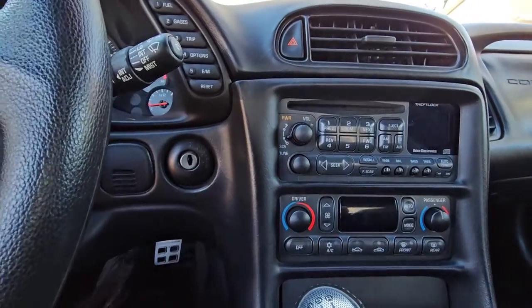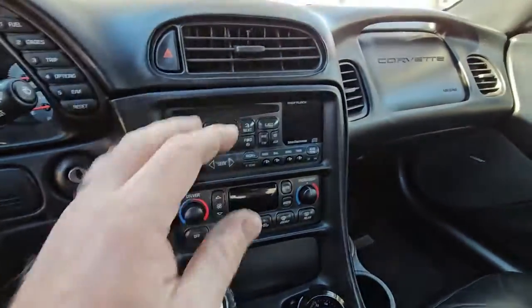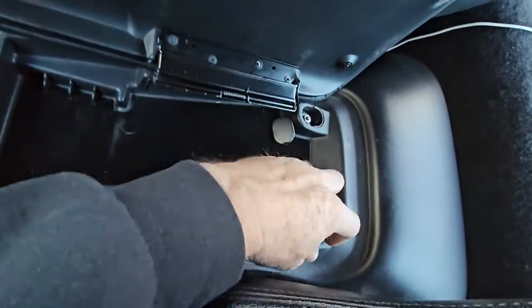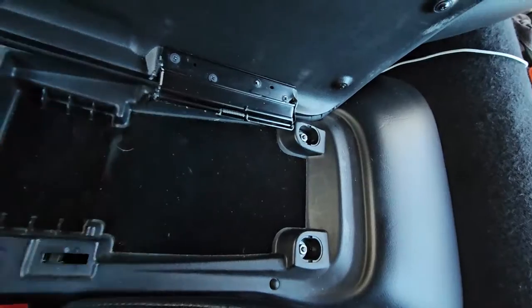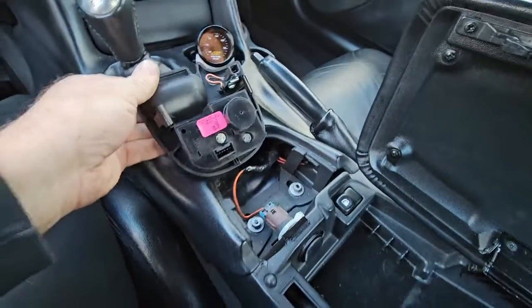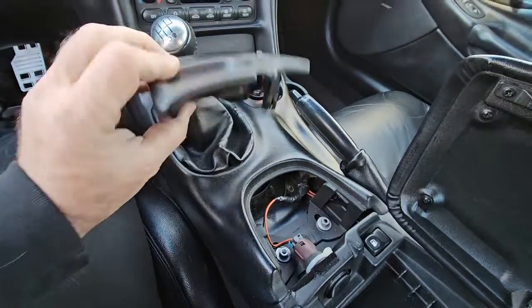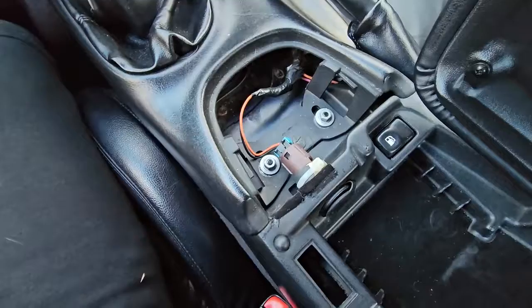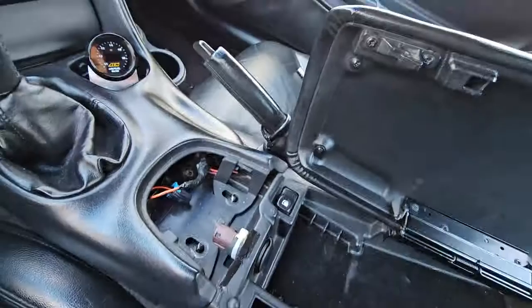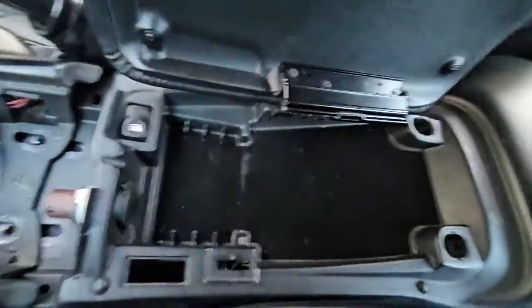Okay, in the car. What you've got to do is get to the area behind your key, so we'll take out the center console. Pop open your center console - there are two caps here that pop out, then take out a 10mm nut on each side. Next, pop your switch panel out. If you still have an airbag you'll have a connector here; if you still have your traction control hooked up you'll have a connector there - disconnect both and set it aside. That leaves your power outlet - pull the plug out of it and take off two more 10mm nuts.